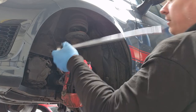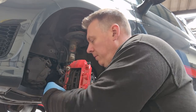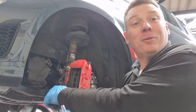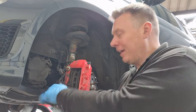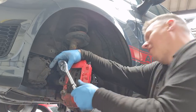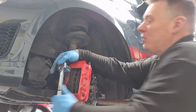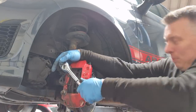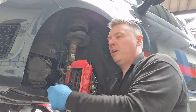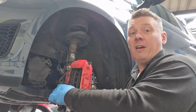You'll need to make sure it's not going to overflow — you may need to take some out. Holding the caliper on are just two male Torx bolts; they are normally very tight so you will need a breaker bar to get them off. The price of these discs are stupid — they're the most overly priced part I've ever had to buy. But the customer did some research and he managed to get them from Eurocar Parts with a 50% off voucher for around £500.